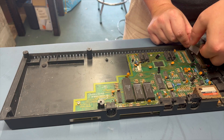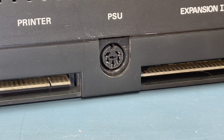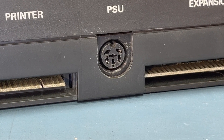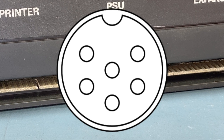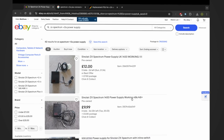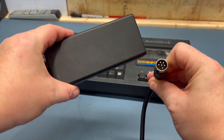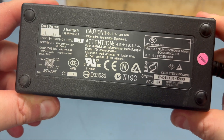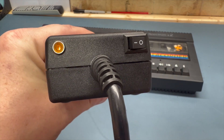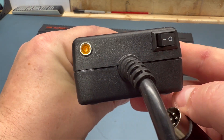Before testing, I need a power supply. These machines don't use the simple 9V DC supply that most other Spectrums use — that would be too easy. Instead, the Plus 2A uses a 6-pin DIN connector which needs to supply 5V, 12V and minus 12V to the machine. I went with a unit on eBay which turns out to be a power supply from a Cisco router modified with the correct connector for the Spectrum. The seller has also added a power LED and a toggle switch, which are both really thoughtful options, and it definitely feels up to the job with some sizeable weight to it.